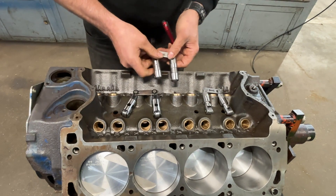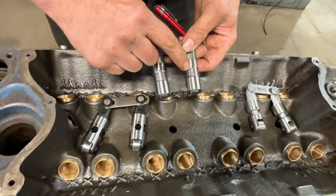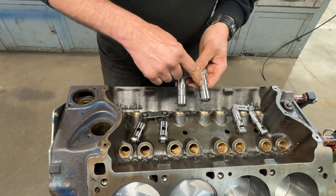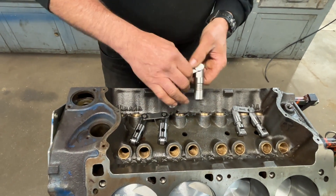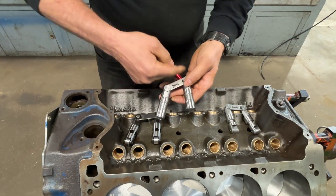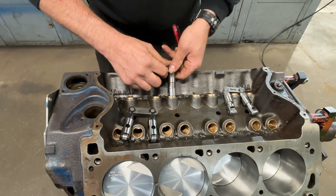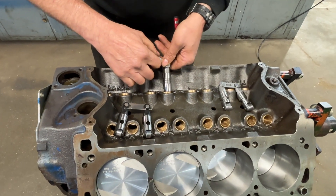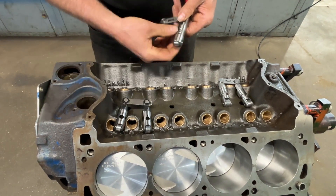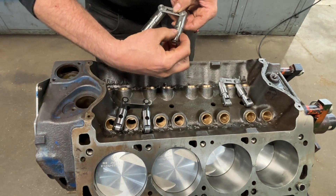Now on the hydraulic lifter, it really works the same way. You'll notice the hydraulic lifter - that oil hole right there intersects the oil band, which is where the oil flows through. So what is inside of the hydraulic lifter gets full flow of oil, but the metering disc inside of the lifter is what controls the oil flow from here up to the top of the pushrod. The other thing that can control that - naturally this is pressurized oil all the way around - if your lifter bores are worn or big, that lifter bore can leak here and can leak here.